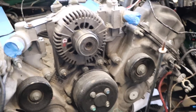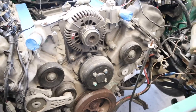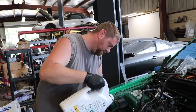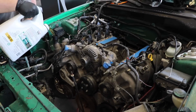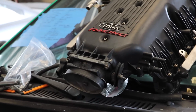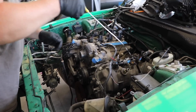Make sure your engine is sealed up — you don't want any metal shavings getting in. We might be getting ahead of ourselves, but I kind of want to start it and hear what it sounds like. No MAF, no accessories, open header, O2 sensors hooked up. It should fire up — without a MAF it reverts to a known good table. I'm interested to see if it'll fire.